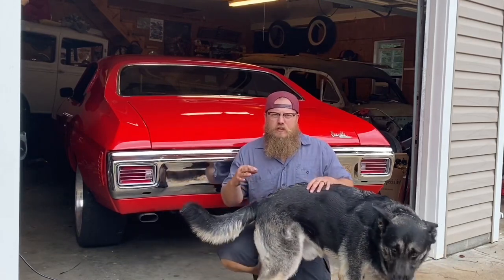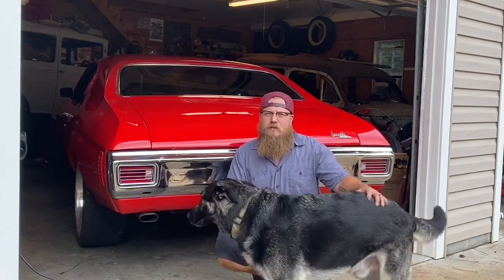I always say make sure you don't put any wiring underneath the insulation. I don't like gluing anything to wires, so I have the wires floating just beneath the carpet, and the carpet's not glued to the wire itself. I highly recommend gluing the carpet in, especially around the gas pedal and the brake pedals. We don't want that coming up and contacting anything like that.